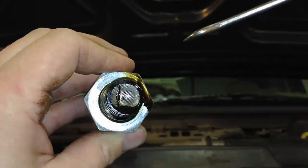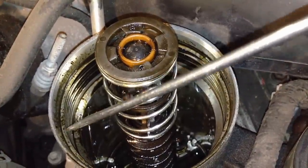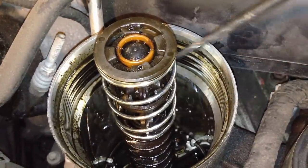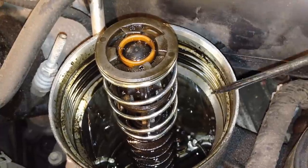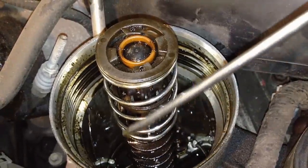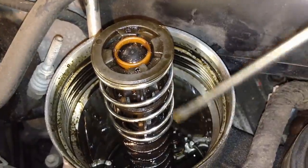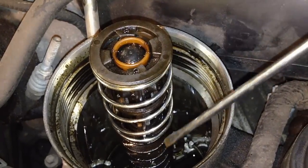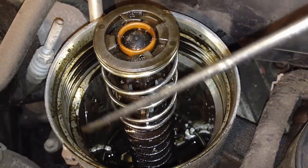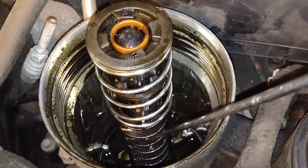There's probably a good view — you can see all this garbage on the outside of the filter housing, which is the unfiltered oil side. The point is there are chunks of garbage through here. If the filter was doing its job and sending clean oil down through the standpipe, the worst you'd get is black soot — you shouldn't have all these chunks floating around. Look at the standpipe right here, all the coating on there.